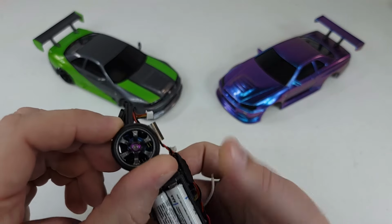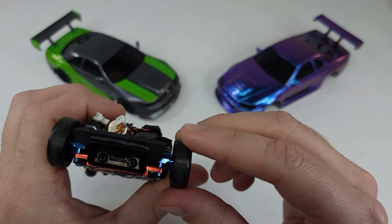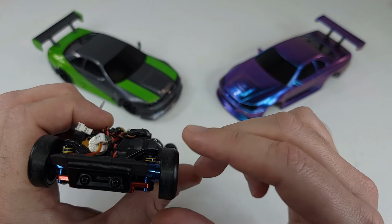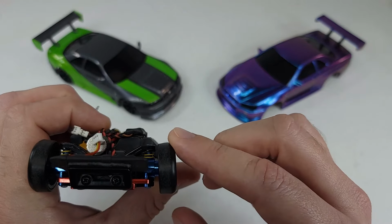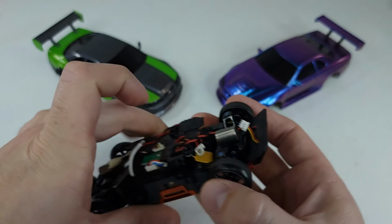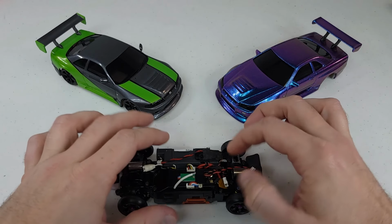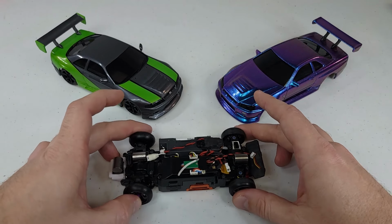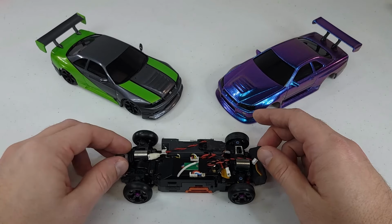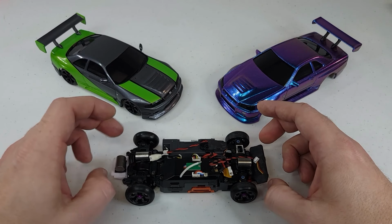And then these wheels here seem to do pretty good as well, because it's a 1.75 degree rear knuckle. And these are 3.0 degree tires, which don't honestly match, but it doesn't really matter. It seems like they get pretty good surface area grip exactly where they're supposed to, so I seem to have okay control in the back end with those. So with these wheels and the weight distribution and then the 1.25 counter steer, it's driving pretty decent on the garage floor. It probably would drive a lot better on hardwood floor or maybe even carpet if I tried some different tires, but for what I'm testing on, this is what I have to do for a garage floor.